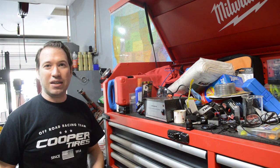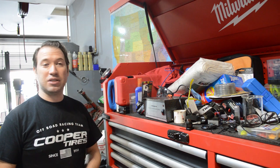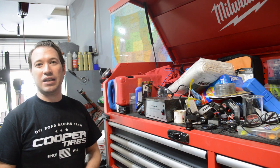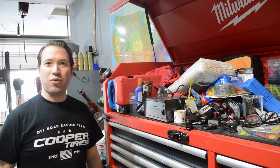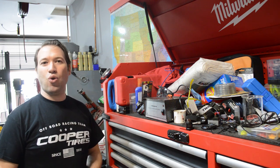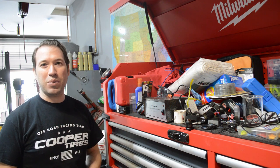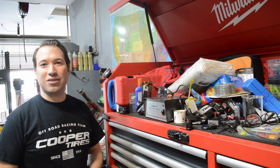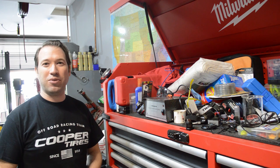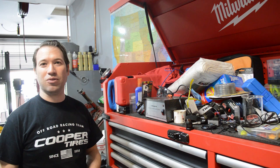On the bench you need a good vise and good lighting in the shop — a set of flashlights is very useful. Make sure you've got shop rags, and of course don't just throw out oily shop rags carelessly. It's not quite as bad as varnish from woodworking, but oil can still combust — so make sure you throw them out properly. Don't just leave a heap of oily rags somewhere creating a fire hazard.